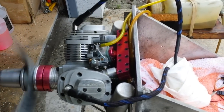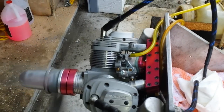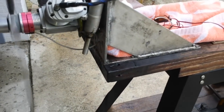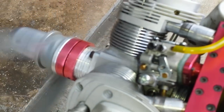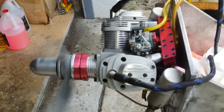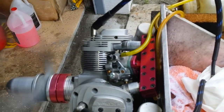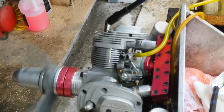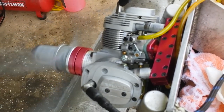I tried different carburetors and different types. Unfortunately, this is all I can get out of it. In order to have the carburetor pump, I had to tap into the port on the air back side, and use the back side of the carburetor to use the pumping feature from there. The inside port that I usually use didn't work — it will not stay running. Probably it's the long intake manifold and the pulse is getting weak during that long transition.